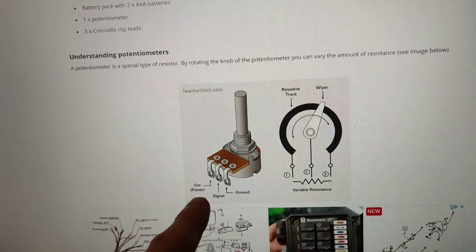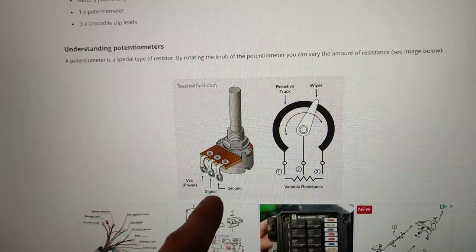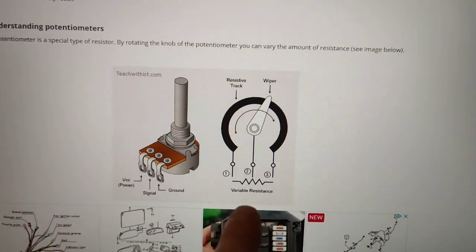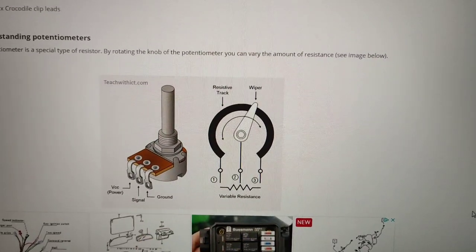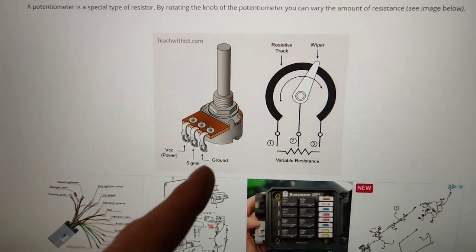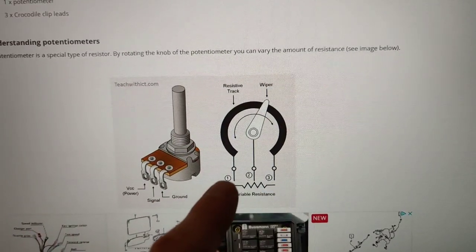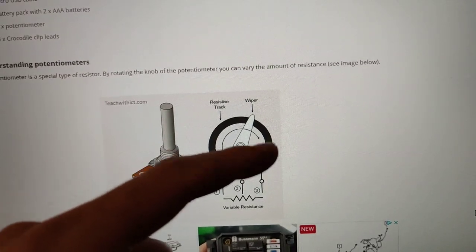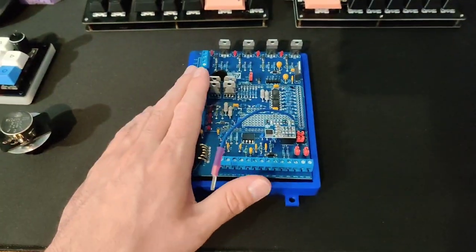You have power, which is a 5-volt reference; your signal, which goes to the TPS wire on your Megasquirt; and ground, which is sensor ground on your Megasquirt. It basically gives you a variable resistance between positive and negative — the 5-volt reference and the ground. Your middle pin, which is the signal, has a wiper that goes back and forth between a wire connecting ground and positive, changing the resistance — so you'll get something like 400 ohms down to 30 ohms. That's all an ECU needs to see.